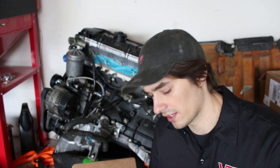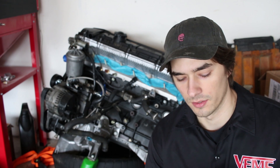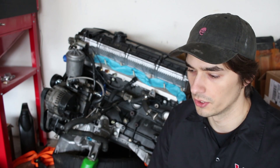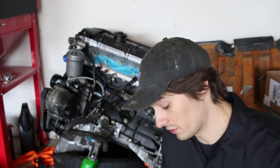Upon receiving this thing, I actually realized just how much time and effort goes into building one of these. Because if you watched my previous build, you saw me working with the Megasquirt and the plug-and-play system. The quality difference between the Vems system and the Megasquirt is enormous. Looking at these connectors, everything is special — watertight connectors, everything is appropriately labeled. There's a little manifold air pressure measuring system. It has a little connector for expansion, so if you want to add pins, inputs, or something like an electronic boost controller solenoid, you can add that using these output/input connectors. It has all sorts of other features, some of which I'd never even heard of before.